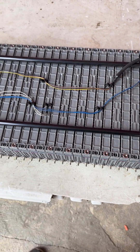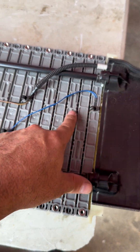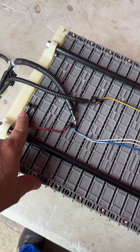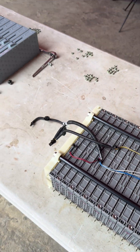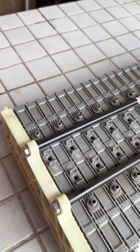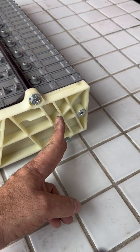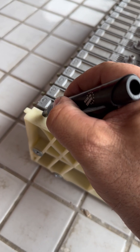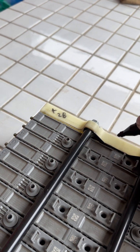Now this part is very interesting. We're using one, two, three temperature sensors — but these temperature sensors, instead of being on the top, are right here on the bottom. We're going to have to find a way to make these temperature sensors match with the new cell battery. For assembly reference: number one is always your main negative, and you work your way up to number 28, which is the main positive at the junction block.